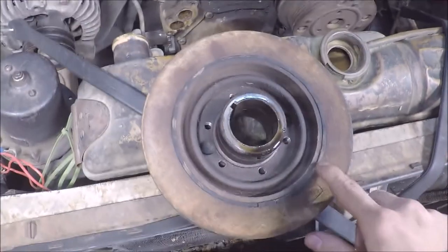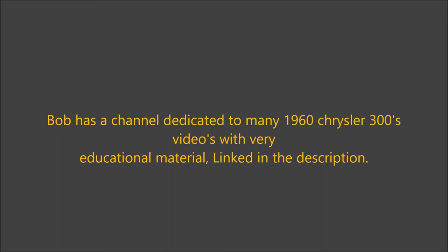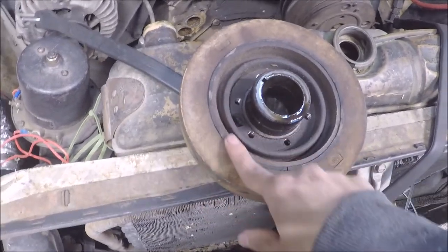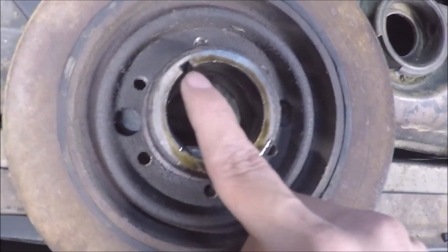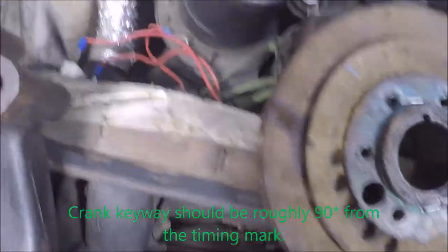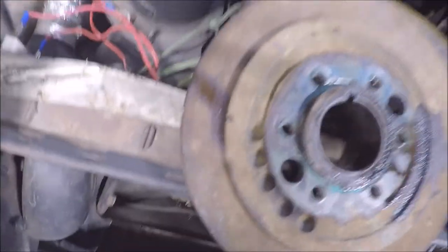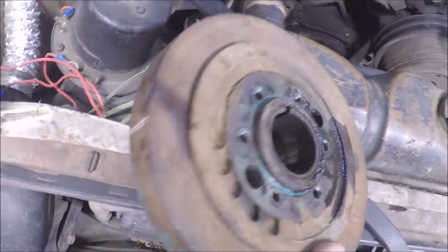I believe there's another channel that I was kind of watching, this guy's channel named Bob. He was going over how to tell if your harmonic dampener's health condition is okay. You look at the crankshaft keyway location, and he said it should be roughly 90 degrees. And indeed it is, it's roughly 89. So yeah, it's close enough. And the timing mark is there, so this is good.